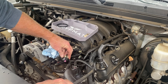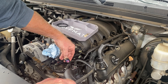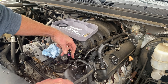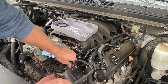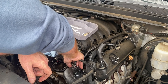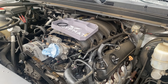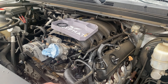The way this works: you lift the white locking tab up so that you can squeeze this to release the tab on it, then literally just slip it back over. Don't want to bend any of those connections. It's clicked in — push the lock back down so it can't escape. Now refill it with coolant, let it heat and cool a couple of times, and call it a day.